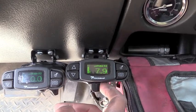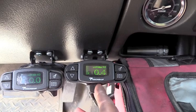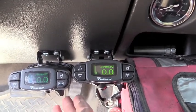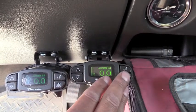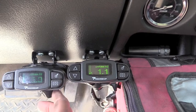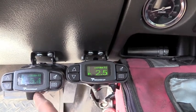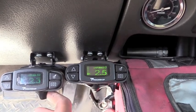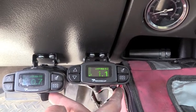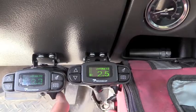I can activate the brakes with this lever on the fifth wheel controller and give it braking power — that's pretty standard on any brake controller. Since this controller is wired into the factory harness, it activates the brake lights when you pull this lever. The second controller is activated by the brake lights on the truck, so when I activate the lever for the rearmost trailer it also sends power to the fifth wheel controller, which thinks the service brake is being depressed. If I have any sway, I can grab that lever for the rearmost trailer to hopefully straighten out, and it activates the fifth wheel brakes too.